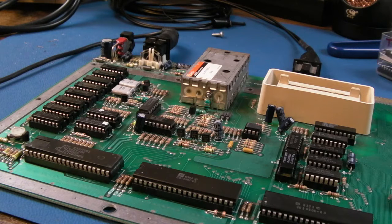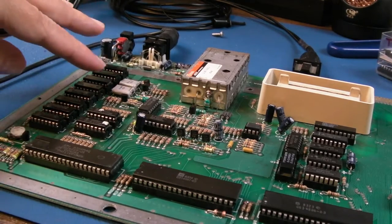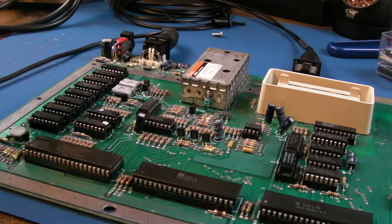So I got an old A500 Plus motherboard, which I'm stripping for parts. I need all the stuff off it for a build coming up on my channel, actually. But the 2 transistors, I thought, well, let's just take those 2 off there, and fitted those there straight away. The colour needed adjustment again, which is interesting, isn't it?